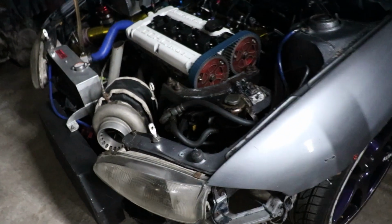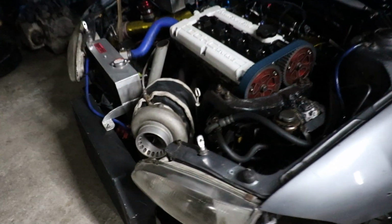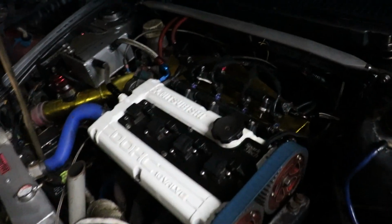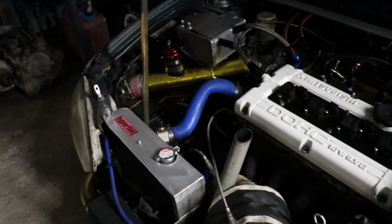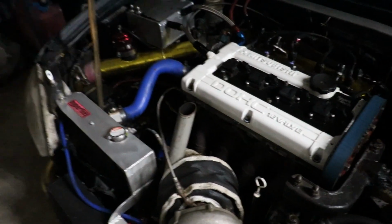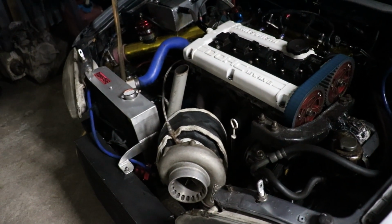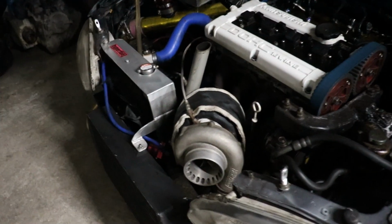Conclusion, the fuel control is working. The fuel system still isn't adequate enough, even with the controller on, to supply the amount of fuel it needs for the gas. Even with the two rails in at 20-24 pounds, the car still needs gas up in them boost figures. But it is a lot better compared to before we put the controller.